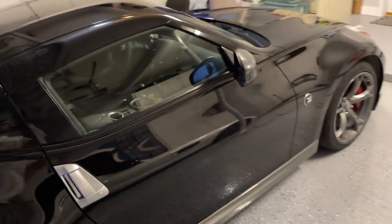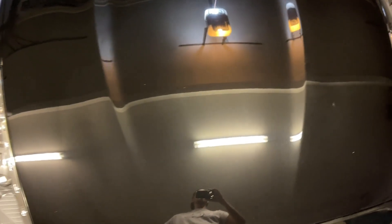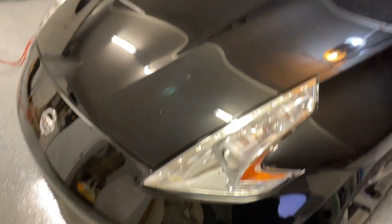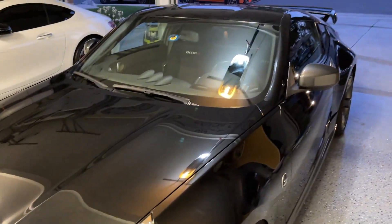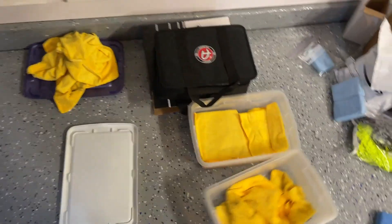I'm going to go ahead and start the polishing process. I did actually bring my one and a half inch polisher today. I'm going to start with the hood and figure out what kind of setup to use, because looking at the paint, it just maybe isn't as bad as I thought — it kind of has some swirls and hazing. So I think I'm going to hit it with some classic cut before I take it all the way to flat top, and I should always start off with a less abrasive compound. I'm excited to see how this turns out and will check back in after the first test spot.